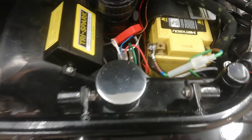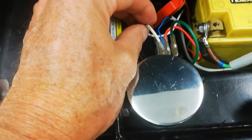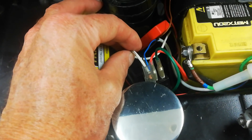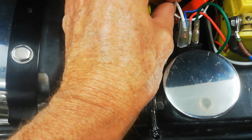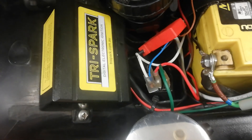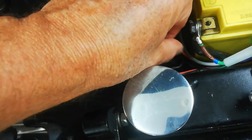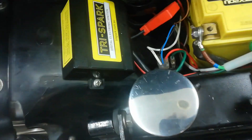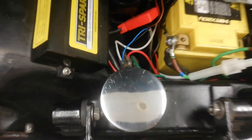It's all wired up now. This is the relay - because the sensor doesn't generate enough current to fire the neutral warning light, the relay boosts the power from the sensor to light the warning light. It's eventually wired up - I say eventually because that is the worst set of wiring instructions I think I've ever read. They were basically completely inaccurate. I've had a word with him and I think he's going to change the instructions. I've just left the relay sitting there for now.